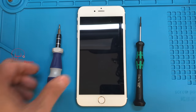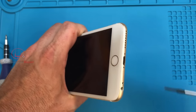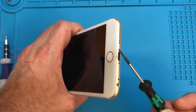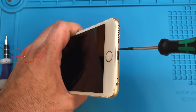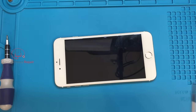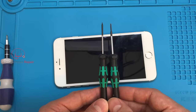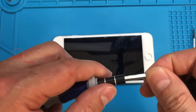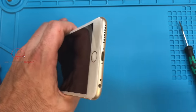If the head of the screw strips out, there are a few different things you can do. This here is a pentalobe screw, and this is a Phillips bit or blade. What happens quite a bit when people work on iPhones is they forget that the exterior screw is different than the ones on the inside. If you interchange those two drivers you're going to have problems. I have a pentalobe driver for the outside and Phillips for the inside, but they look very similar, especially if you buy the same brand or use a kit where you switch out tips and might just forget to do that.